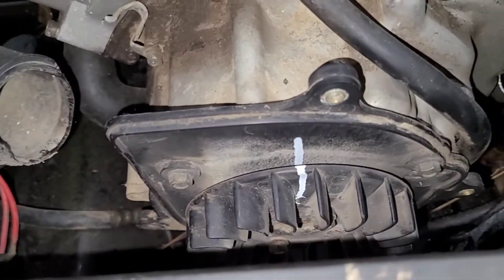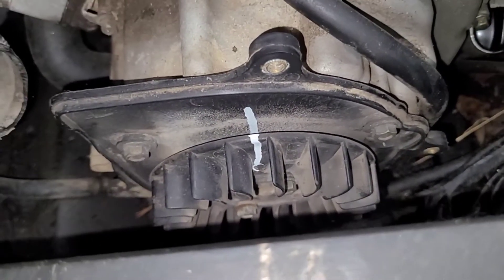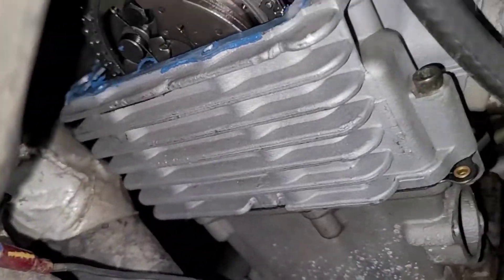When you do that, take your paint pen and mark two things: one mark touching the crank and one mark touching the engine — that's your top dead center. If the people that brought this in had known that, they wouldn't be paying me to retime this engine.